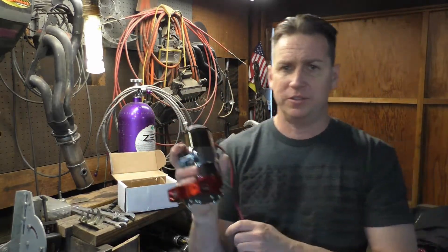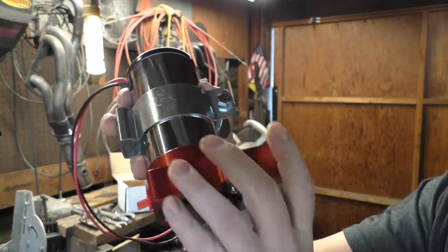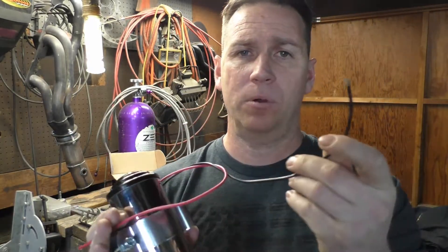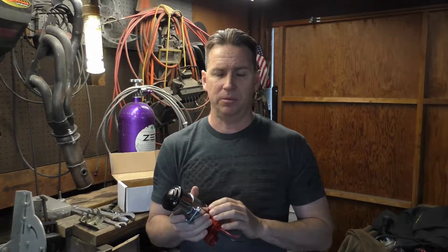The finish of the pump is relatively nice and very straightforward on the wiring — of course your ground and your power supply. Typically on these pumps, especially a high-flow pump, I like to bypass back into the tank. It just prolongs the life of the pump and it also keeps the wear and tear on the internal parts of the pump to a minimum.